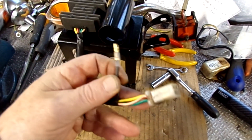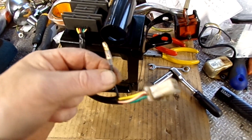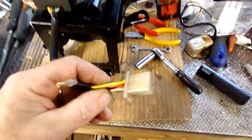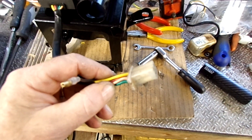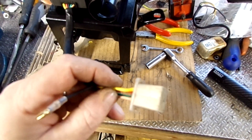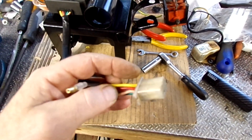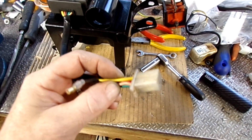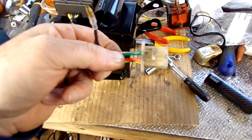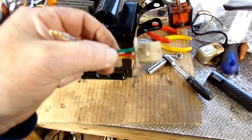There's the plug on, and that's the little bullet connector. So this is the switched 12 volt. The pink and the yellow are the two AC inputs from the alternator, the red goes to battery positive, and the green is ground.